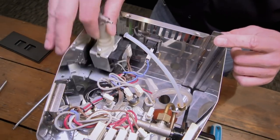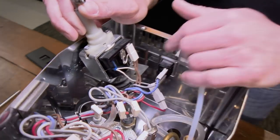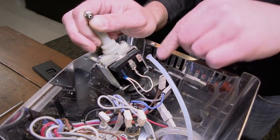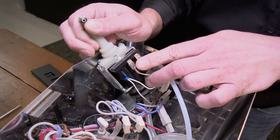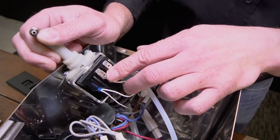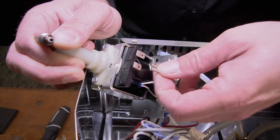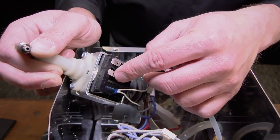After we got the screws out, we're going to pull the pump up as far as we can so we can unplug these wires right here — most of the time they will just pull right off. If they don't want to pull off, you can use a screwdriver and kind of wedge it in there and pop it off. This one here has a little thing sticking out in the middle right in front of my finger. You can push down on it — it's a little lever — and when you push down, you'll be able to slide that right off. It basically locks and releases a little pin in that hole.